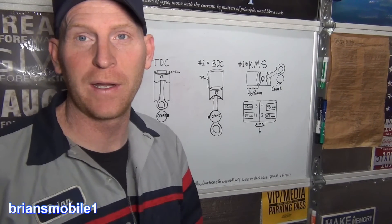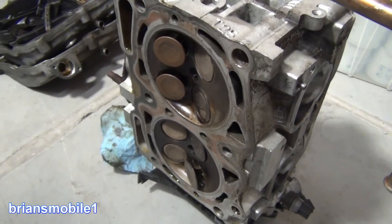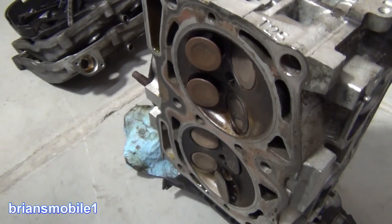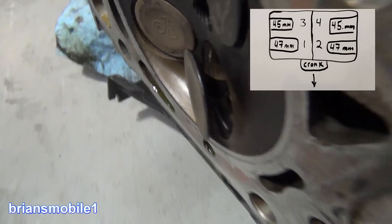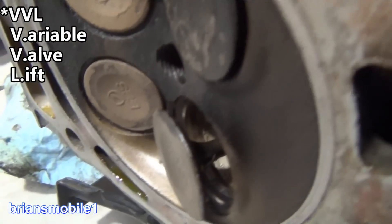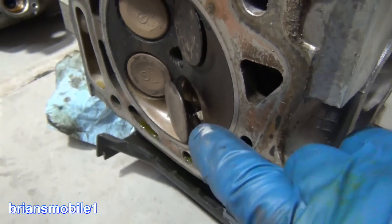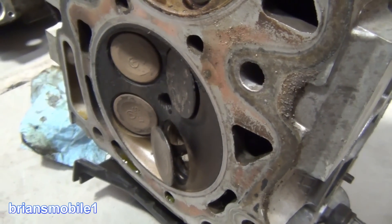I've got a couple of cylinder heads pulled off right now. Here's the cylinder head — this is from the driver's side, this is the one that flipped. The furthest the valves are going to stick out is this: the exhaust valves are going to be sticking out this much on the back cylinder, cylinder 4. On cylinder 2, the one in the front, because this has variable timing with solenoid sensors and all that, it has the other one in a little bit. That one right there sticks out about 8 millimeters, and there's an allowance of about 4 millimeters for the cut-in on the piston.